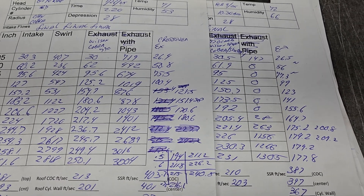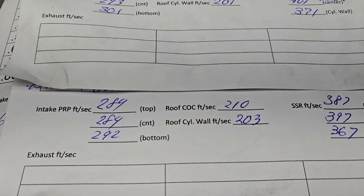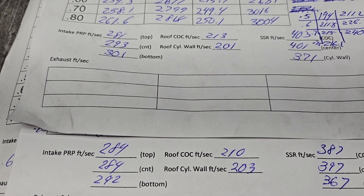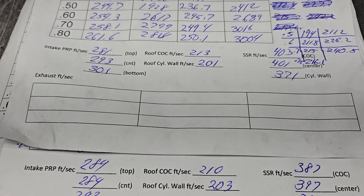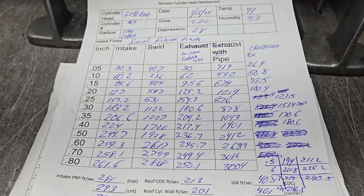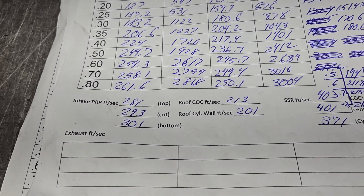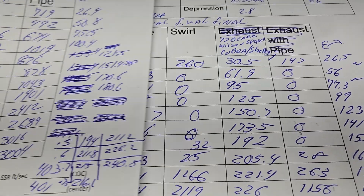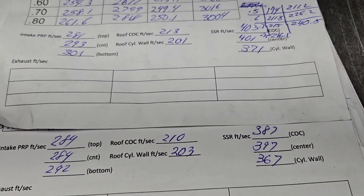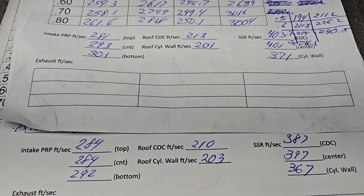Top page is seven, we're going to look at the air speeds, then number five air speeds. Pretty close on our pinch. The roof on those two ports is almost identical — we've got a little more speed on number seven but it's also flowing a touch more. Actually it's 254 to 254, almost identical. It takes so little — literally a couple thousandths change on the short side radius and you can alter your speeds like that. Both of these ports I think will run great.